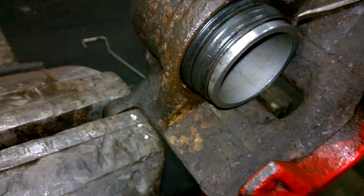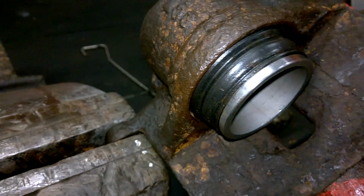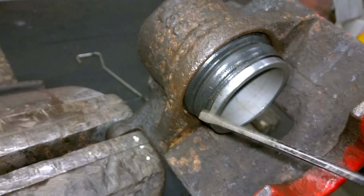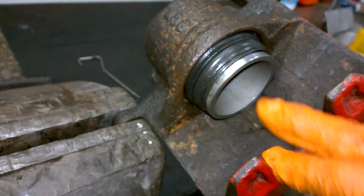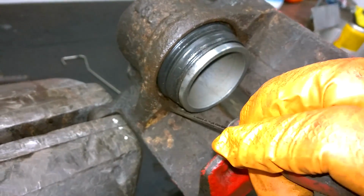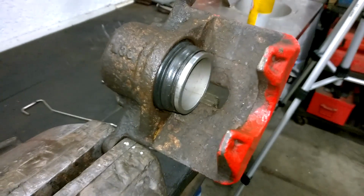What I find the easiest when fitting those is to put this rubber on the piston first, like you've seen in the last clip, slide it towards the very back of the actual piston, and then when you're pushing it forward, this is loose on the inside and you can just fold it in around. I always start with the hardest part first, so I tilt it back. I fit the base side where it's very difficult to put the screwdriver in. That means that you have like 180 degrees afterwards, which is free, and you can fit that in a lot easier. That is how I got it in, and that is how that seal is complete now.